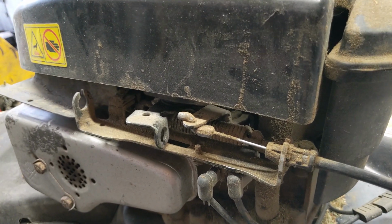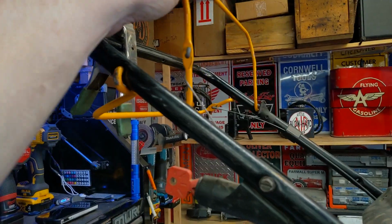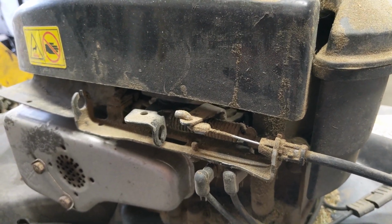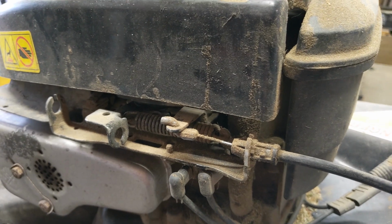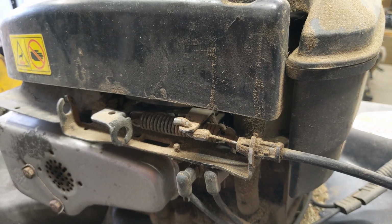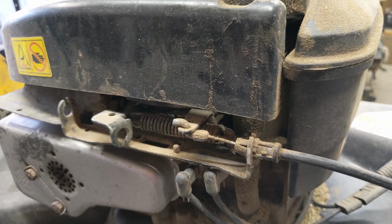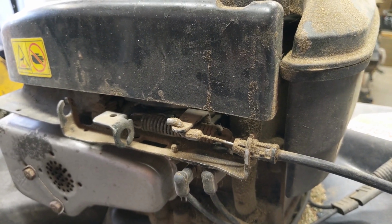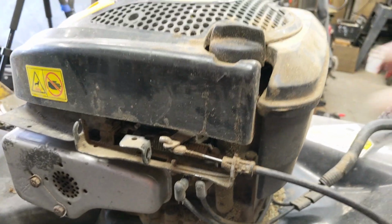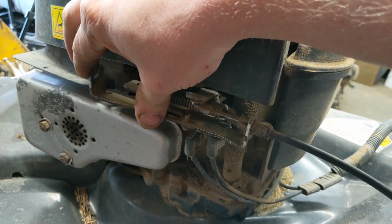Over here you have the shut-off switch and brake control setup. I'm pulling the handle bail lever right now, and you can see how it pulls back. But a lot of times it will stretch to the point that maybe that's as far back as it pulls, but it just needs that much more to turn off the spark killer, the mechanism that grounds the spark. So sometimes pull the bail back and put a pair of pliers or something on there and wrench it back even more by hand, and see if that's enough to make it regain spark.